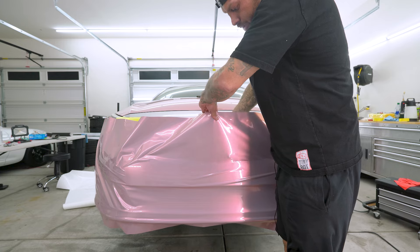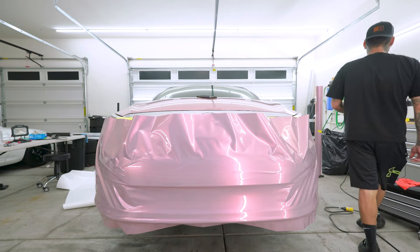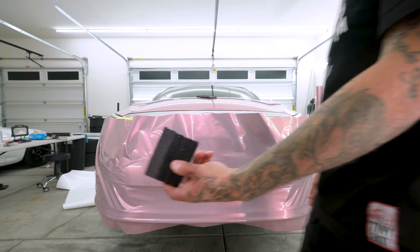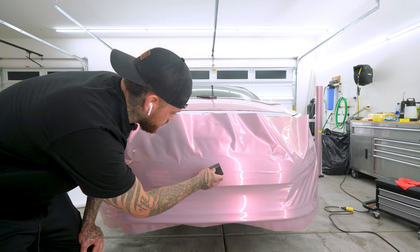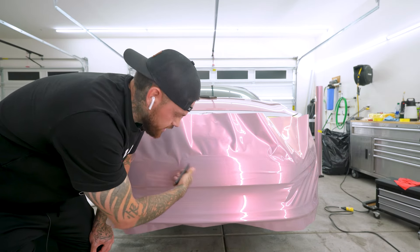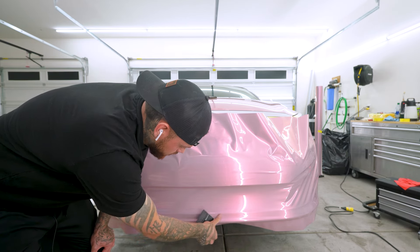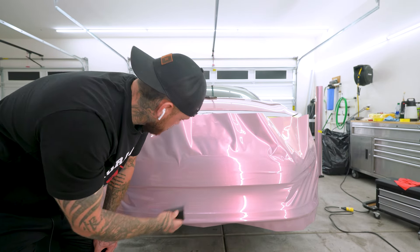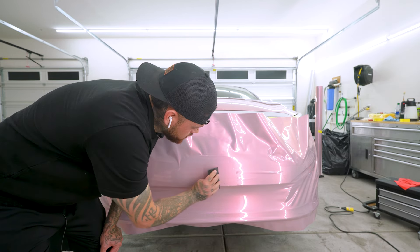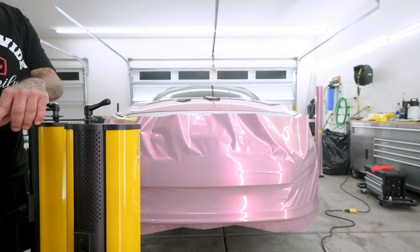And that was my cold stretch. I'll come back with my squeegee — I always put my slippy solution on my squeegee. I want to pick a hinge point, because if I don't, as I keep pulling up, putting down, pulling up, putting down, it's just going to keep lifting. So I want to make sure I pick my point and I'm good with it up to there.